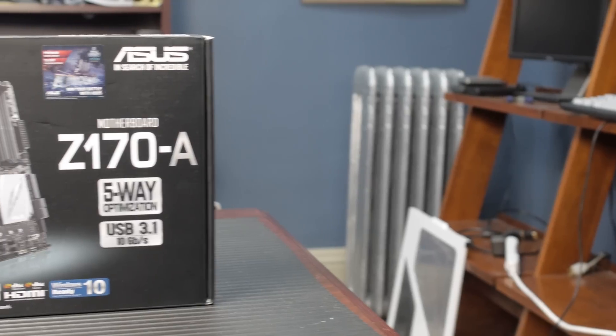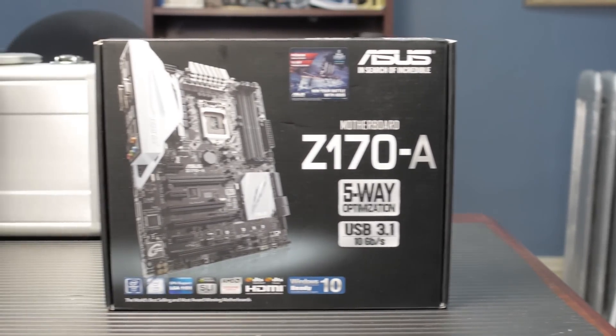The crazy thing about this RAM is that it's DDR4-3200, and there are Skylake motherboards out there that are not rated and certified to run DDR4-3200 at that speed. In the case of the Z170 Deluxe from Asus, the maximum speed on the box is 3466, though we've seen people hit 4,000 using a single DIMM. Some other motherboards, like the Asus Z170A — the lower-end version without as many features — only advertise a maximum of DDR4-3400 on the box. So keep that in mind when shopping for a motherboard if you're going to get fast RAM for Redis or something super memory-intensive.